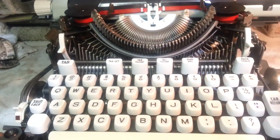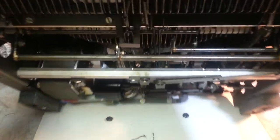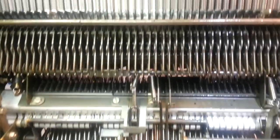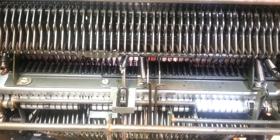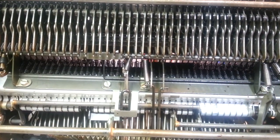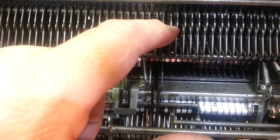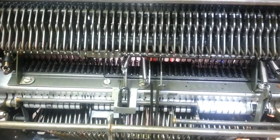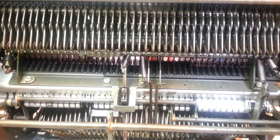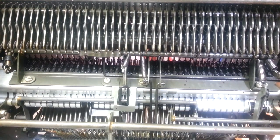The real trouble was this keyboard underneath here. Let me see if I can get this thing on its back without killing myself. Oh, this thing's heavy. Heavy for portable. So these are the latches right here. They're all gummed up. I'll turn this on right now, and you can see it fire up. So those latches triggered off, but there's a couple pivots here, and just about every one was stuck. And even when we unstuck it, it restuck. But now I've got them all flushed out pretty good here, so I think we're good to go.